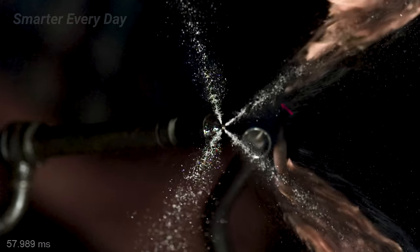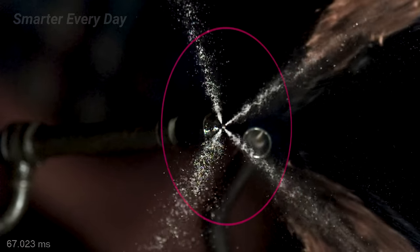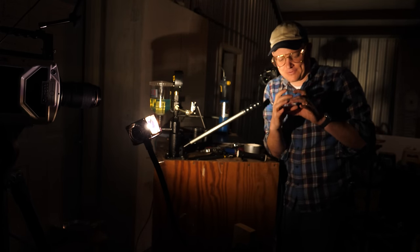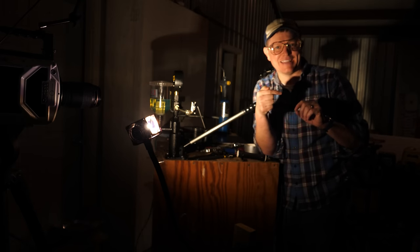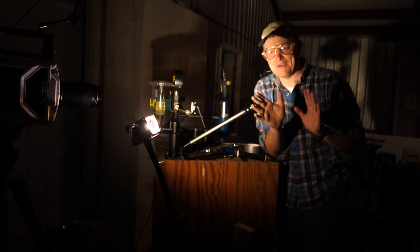So there's this radial boundary that it can't backburn into. I don't know what you call that, but we just saw it. It's like the fuel and the air have to agree that, okay, now it's time to burn. And the fire is trying to run backwards, but it can't quite get there because the stoichiometry goes back to fuel rich. Very interesting.